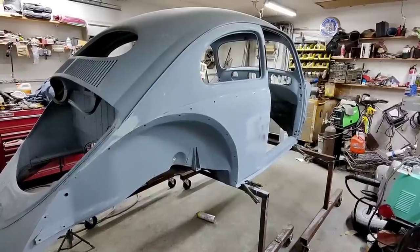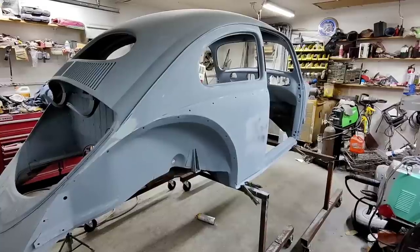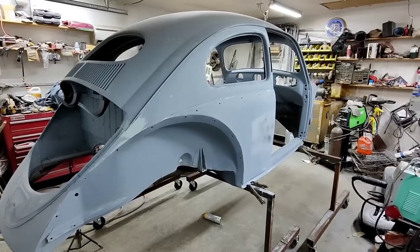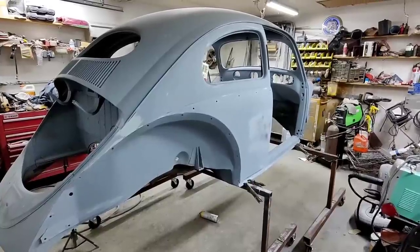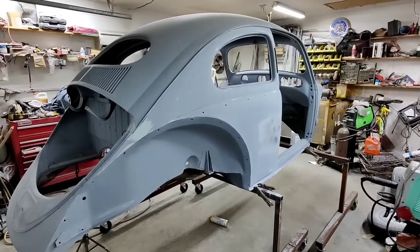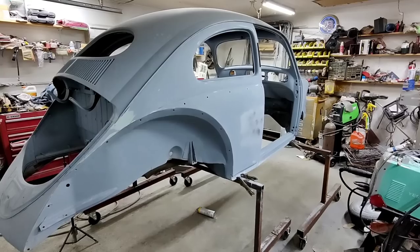There's nothing wrong with it. The results are really good. It lasts a long time. Now, this is the way a lot of guys did this stuff for years. A lot of people did lap welds and spot welds and filler, lap, tap, and fill. And that's why it was done for a long time, because you barely had a flux core welder. That was kind of a new thing in the 80s, and all you could really do is spot weld with it. So guys did that and it worked.